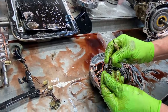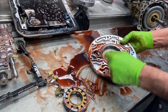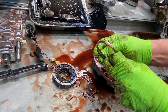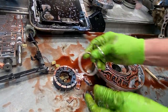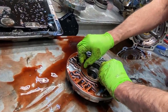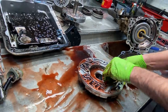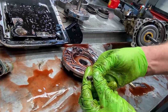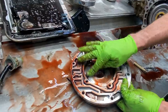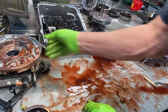Of course we have a dual spring slide and a 13-vane pump rotor kit. Look at all them rotors in there — really nice pump. What I like about these dealer ones is they put stainless rings in them. A lot of the overhaul pump kits come with steel instead of stainless, so if we're building a high pressure unit you always want to put stainless in there, not steel. Pump slide is starting to get the bluing worn off. That's how you want to look here for any type of wear — scotch-brite this up really good if it looks good. New seal, bushing, retainer back on there. Pretty simple.